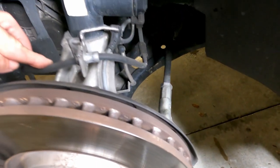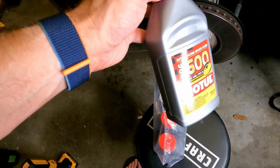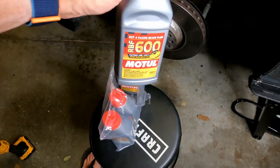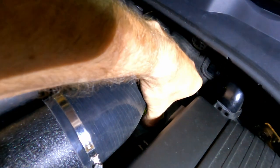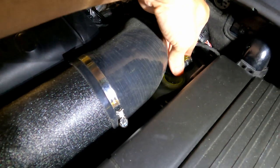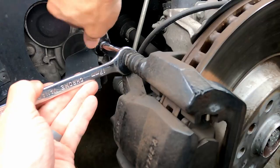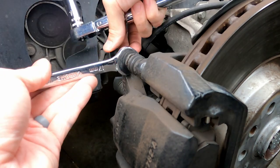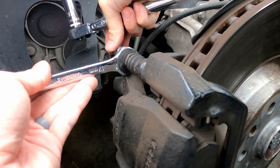I'm also doing RBF 600 — a racing-level brake fluid — so when I do my bleeding I'll go ahead and flush at the same time. Now I'm loosening up the master cylinder cap. I'm checking to make sure it's not super full, because when we compress the piston back into the brake caliper we may spill if it's too full — which I'm not in this case.